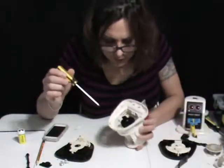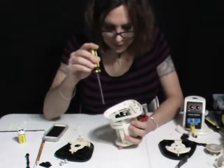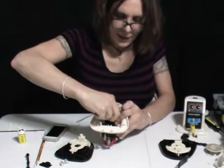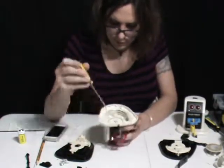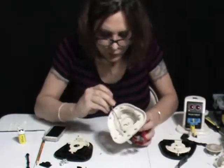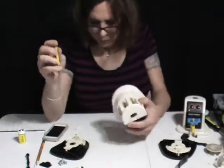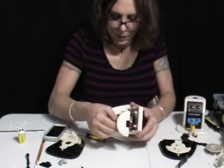This is pretty disgusting. I can't even wipe it out, so I'm going to have to take the rest of this apart. First of all, this is the vacuum impeller here — it's the only thing with a different screw. That comes off like that. It uses the same screws throughout — Tomy was smart like that. Two more of the same screws. There we go.